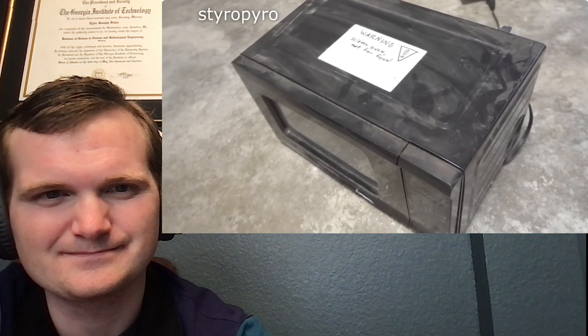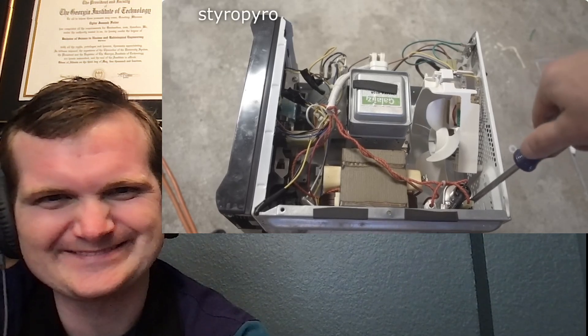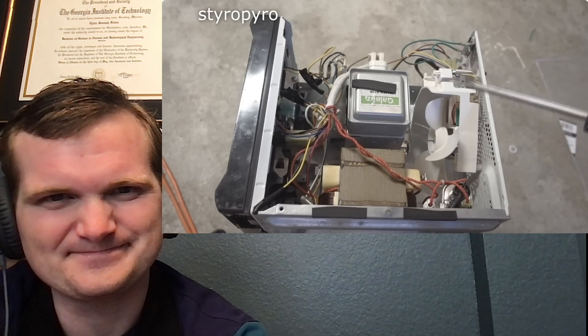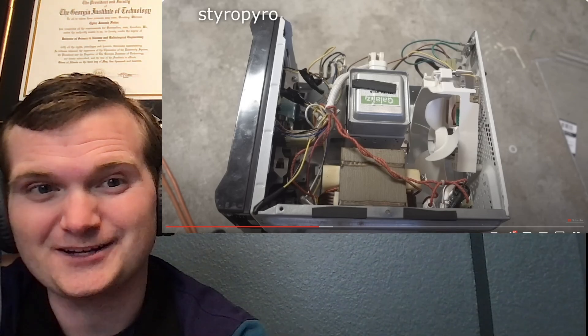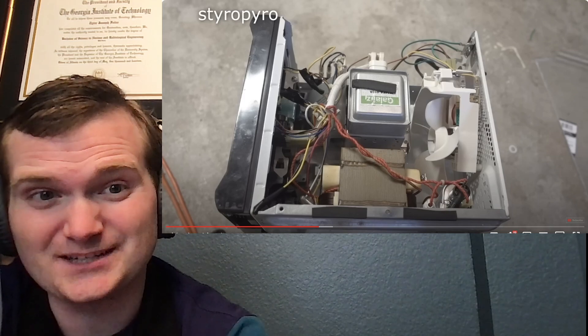Microwaves are full of parts that are useful for the electronics hobbyist and can be sourced cheaply, even sometimes free. Nobody without extensive electronics experience should ever go poking around in a microwave. Reason being: touch the output while it's live, you're dead. Touch it without discharging it first, you're dead. Break the magnetron and inhale the dust and before long, berylliosis comes creeping in, slowly suffocating you until finally you're dead. Forget all the people who are afraid of ionizing radiation and radioisotopes — tearing apart one of these if you don't know what you're doing is a legitimate hazard.